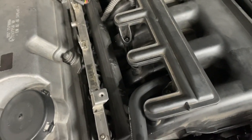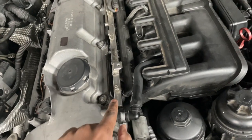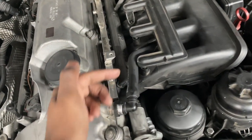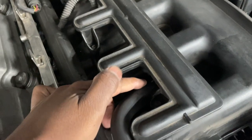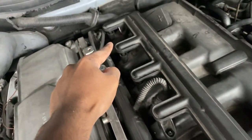You can use another fitting with a combination of your old CCV hose. I actually used the old CCV hose fitting from the M54 cover — I could put it over there as well but I think I lost that one. So what I did was take the original fitting and cut off the other part for the branch that used to go over there.